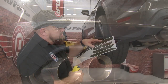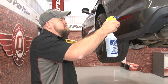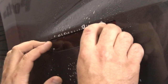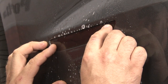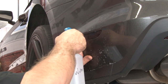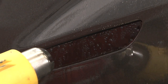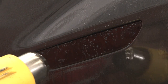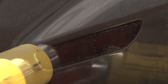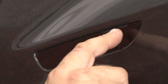Now move on to the side reflectors. Same process on the sides — these are labeled driver and passenger, so make sure you grab the correct one. Get it pretty much centered, grab your water, then center it and grab your heat gun. Always work center outward whether you're using the heat gun, drying it, or squeegeeing it. Just like the rear reflectors, once you start getting some adhesion you'll see the letters starting to poke through.